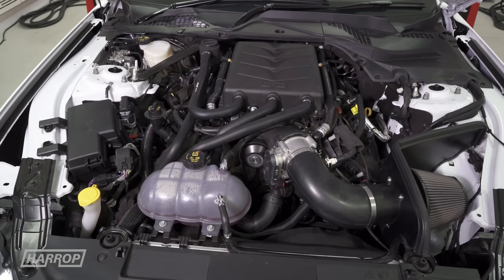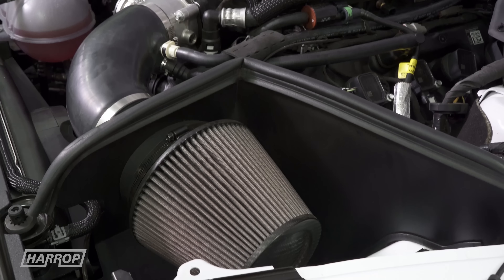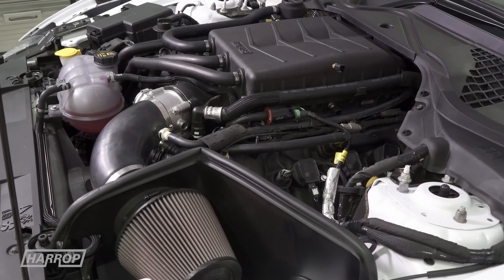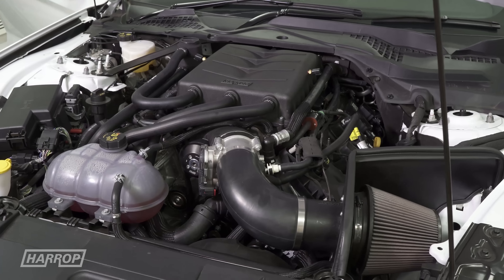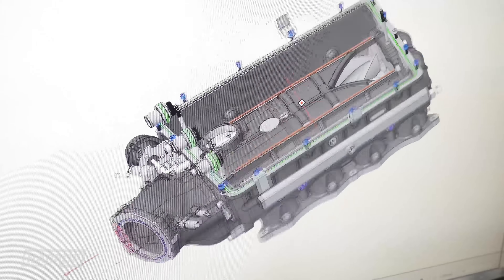Looking at our hardware for the cold air intake, we have increased the diameter of the MAF tube and retained a serviceable K&N pod filter with open top air box to remove the factory air restrictor. The throttle body flange on the new system is designed to accommodate the factory throttle body or up to a 100 millimeter aftermarket alternative.